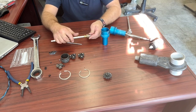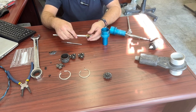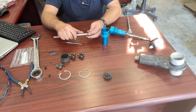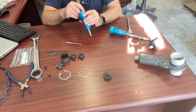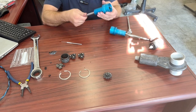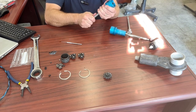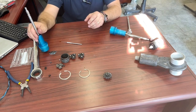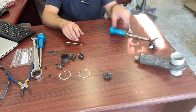One of the things I'm looking at here is on the shaft — I'm looking to see if any of the bearings are worn into the shaft. You can see there's a little bit of shine right there, like it's starting to wear, but it's not worn down at all, so I'm not going to worry about that. Then I'm going to make sure it feels good, no real slop to it. That all looks good. If I change out the axle to the new style, most of that goes away anyway.